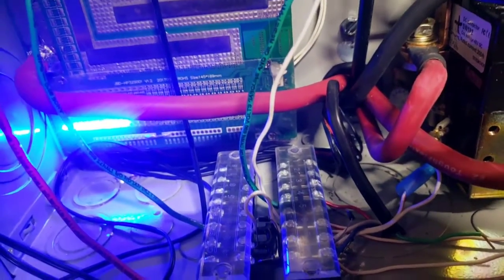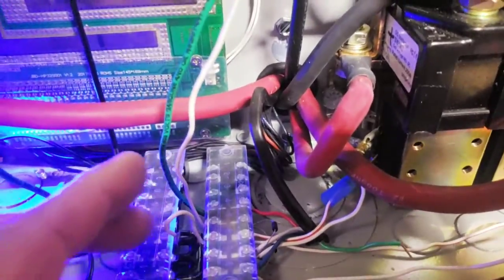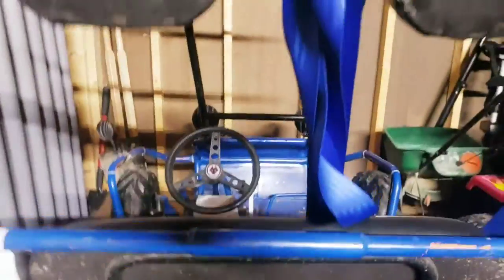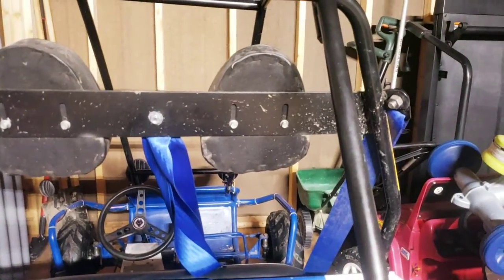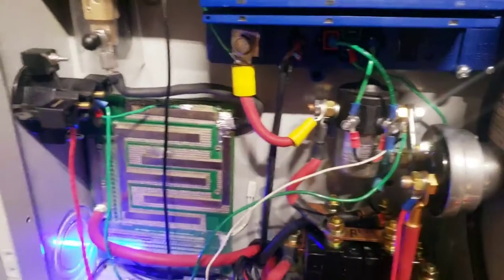This big white wire right here comes into my bus bar down here. I funneled my four-in-one cable to the front where I have mounted my switch box. The red wire down here feeds all the 48-volt power needed up front for the key switches and forward/reverse switching, and it will eventually be used for my 12-volt down conversion, but I haven't hooked that up yet. The headlights aren't assembled yet — I'm going to add another hole and another switch to that panel.